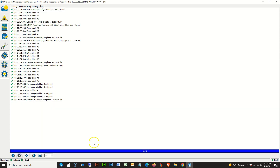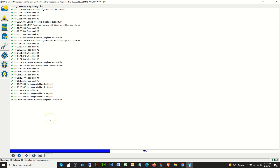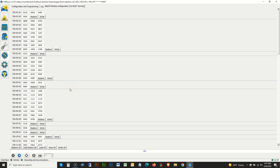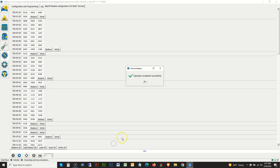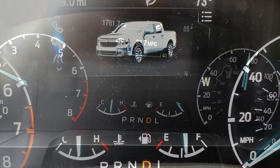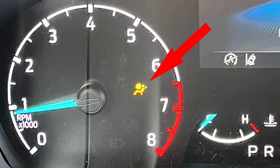Click stop to disconnect, then click on the Configuration tab one more time for the last step. We need to go into the Body Control Module As Built option, agree to the warning, and wait until all options are fully loaded. Here we're going to look for sector 726-04-05. We're going to change the third box in this sector to read 8872 — but not before making a backup copy of the OEM configuration. Click Save All and label this copy OEM as before. After changing the third box to 8872, click Write All, agree on the prompt, turn the key off and on, and you are done. Your Ford Maverick now has cruise control! You'll be able to see the active icon on the center of the dash.